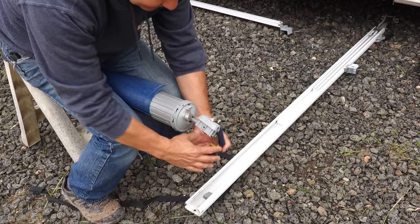Now I placed part of the arm over there behind those cinder blocks to give me a little bit of leverage. There we go. Now before I take it completely off, I want to mark this track here, just give it a number. Just gonna give it a line here, so I know that this is the track where the main bead goes. All right, I'll put another two here, just so I know. All right, a couple of marks, so I know where to put the new awning.